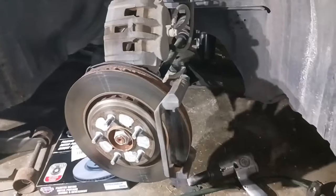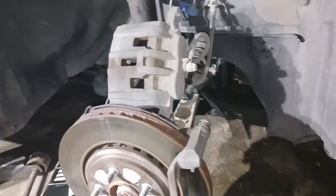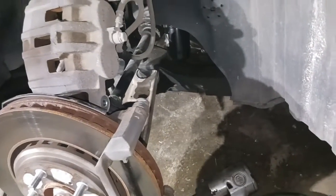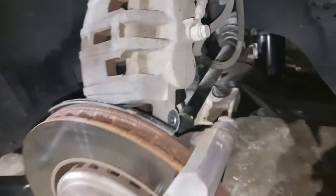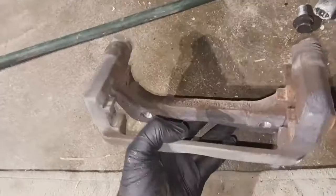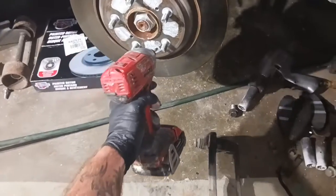Make sure you keep your brake caliper up where the line can't get pinched. If it's sitting down and it's an older brake line, it can actually damage and collapse your brake line and then it'll cause dragging brakes. That's happened to me. High front brake caliper bracket — now you've got to get off that little Phillips head right there.